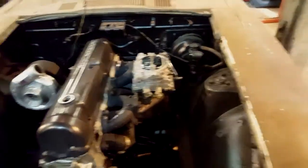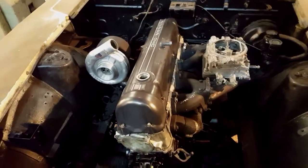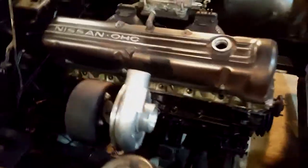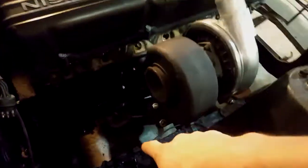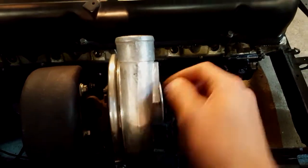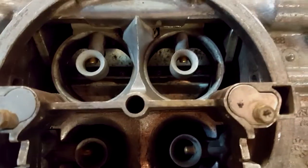What's happening is not necessarily a bad thing but it's also not good. It takes the life out of your turbo slowly depending on how much boost you're running. So the exhaust comes down, wraps around the motor, comes up through this pipe into the hot side of the turbo which spins, and then you have your exhaust coming out to a pipe that goes somewhere down in that hole. When this is spinning, it also spins the compressor wheel, and that's forcing boost into your carburetor. Now in your carb, you have butterfly valves — let me get a flashlight so you can see them.